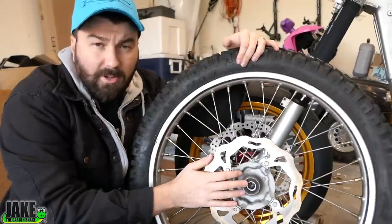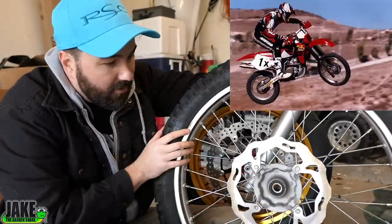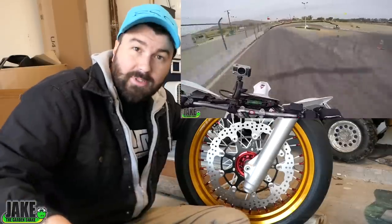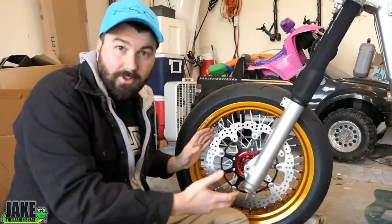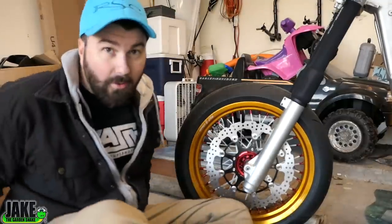Honda on and off-road motorcycles, 70 to 350cc. We're going to be completely beefing up these brakes and making them better. The brakes that come on the XR, it's not that they're necessarily bad — they were fine for what it was built for, running across the desert. Convert to a supermoto like this and now it's the complete opposite. We want a lot of front brakes. The Warp 9 kit already gives you this oversized rotor and a relocation bracket, but we want to take it even further than that.